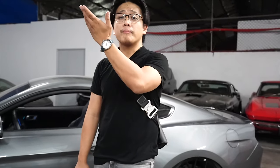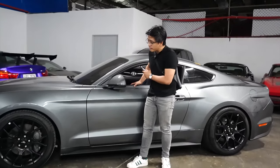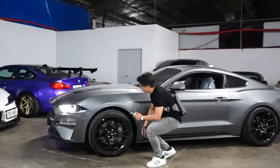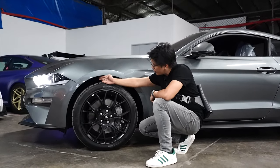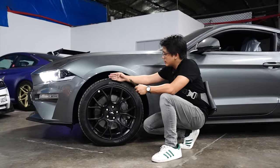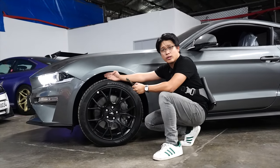Now we'll show you the vehicle dynamics of the car — we're going to raise the car up and see how far the lift is. Let's give it time. For the front side: we're putting 80–90 PSI on the front, and it's right about four fingers of clearance. Each finger is roughly 15–20 mm, so you're looking at about 60 mm of lift capability on the front — maybe even 4.5 fingers, it's quite loose.